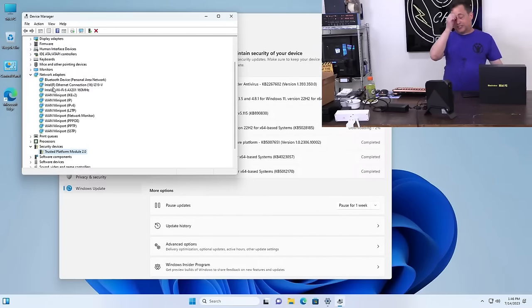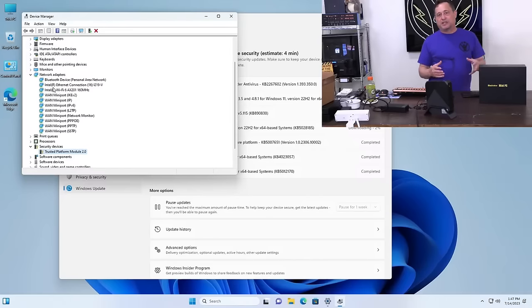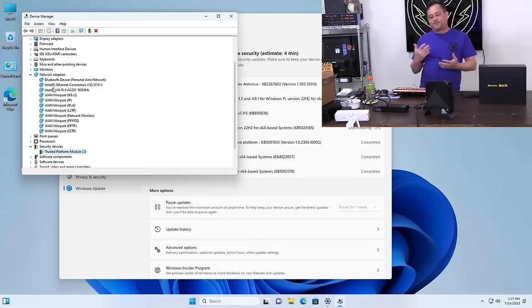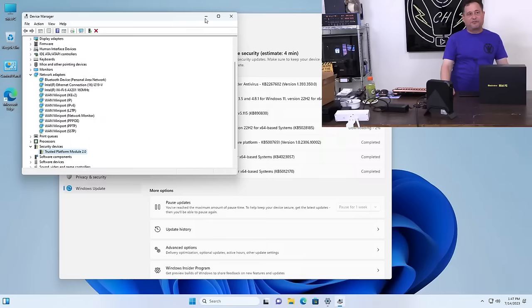The reason why this is preferred when it says Intel is we can use the Intel Driver Assistant. It's free from Intel to get updates on drivers for any Intel hardware in our computers, even if those are AMD-based computers. So when you have a mixture of different hardware, you're getting your drivers from different places. If most of our equipment can be all from one company, then it makes it a lot easier to just go to one place to get those drivers. So things like your Wi-Fi, your Bluetooth, your LAN, if you can get that Intel on an Intel system, which has Intel drivers for video display that get updated regularly, it's just one-stop shopping, you know what I'm saying? And then you don't have to get your drivers from some questionable source. It's coming from the manufacturer directly, and that's completely free for you to use.